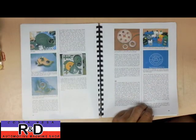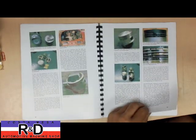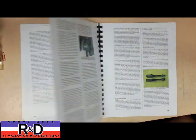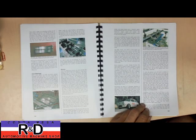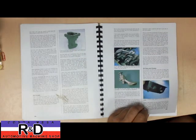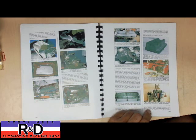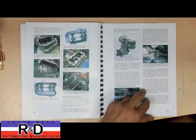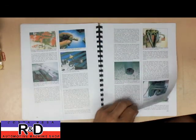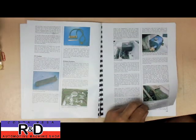As far as engine prep, let's talk a little bit about oil. That's very important. Talk about the cylinders, different styles of pistons, which there are many. Talk about the cam bearings, how to put a 600 cam in a Fiat 850 engine to reverse the rotation. Oil pans and sumps. Oh man, we've been through a number of oil pans and sumps here. Different iterations, trying to reduce windage inside the crankcase. Talk about some water pumps, radiators, exhaust, which is a big deal on these cars.